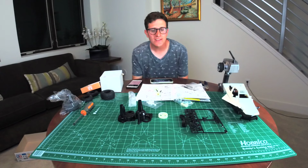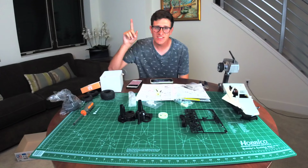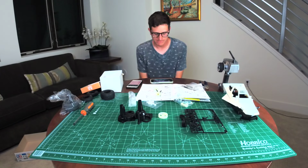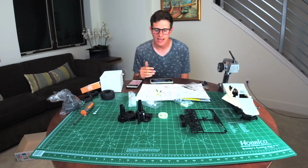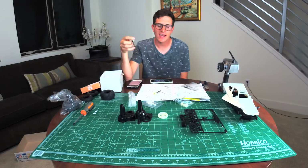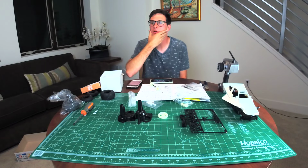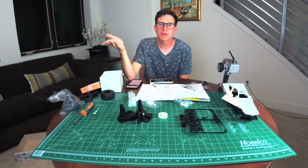And then the craziest thing happened. The original owner contacted me and said, yeah, there was an engine fire, and we put an engine out of a Brazilian van into this Volkswagen with, get this, 6-to-1 compression. So I had it over at our little 0 to 60 testing, and it was super slow, like over 30 seconds to 60. And then over at Bandimere on the big Beetle day there, another guy in another 71 Super Beetle ran like a mid-20s in the quarter mile. And I'm like, well, that doesn't make sense, because he was going slightly above 60 at the end of the quarter. Well, 6-to-1 compression makes total sense now.